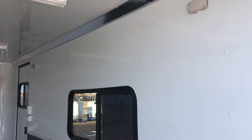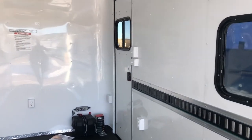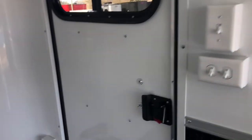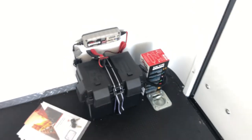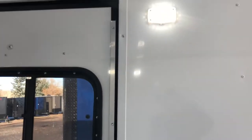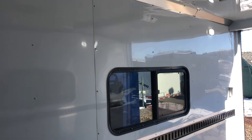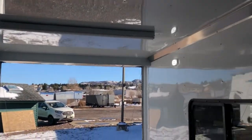Two of the pucks both have toggle switches on them, and those are linked to a light switch off your side door. These 12-volt pucks run off the internal battery inside the trailer — you've got a battery, a battery box, and a battery charger. That's going to run your interior puck lights and those exterior spots, allowing you to have light without being plugged into a vehicle.